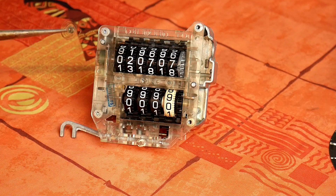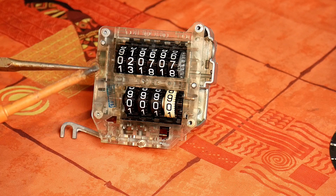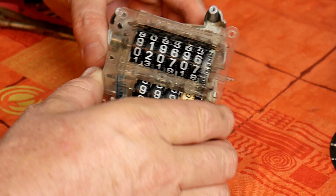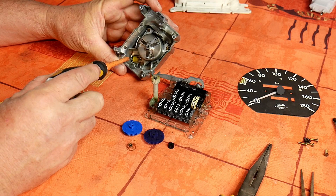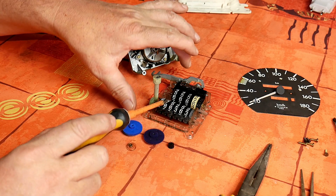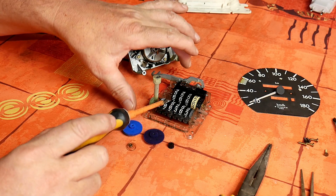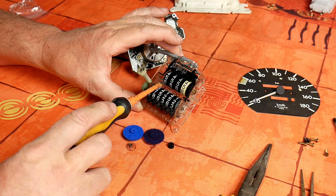In the middle here we've got a little clip — we have to pop it up. Use a flat screwdriver or something and gently pull it out. Once it's out we can open it and have access. Here's how it works: the speedo cable turns here, and we've got a worm-end screw. This one turns, makes this turn, this turns and makes this one turn — that's the normal kilometers. Then this is linked here to the one that you can reset.